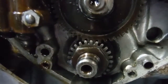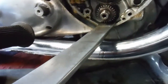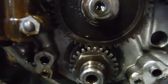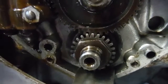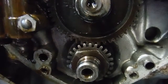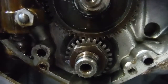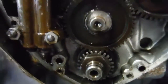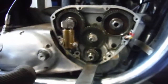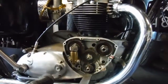Amongst other things, I found that there's a bit of play in the main bearing. Look at that lever there, just underneath the timing pinion — and hopefully you can see that. If you watch the oil from the teeth of the gears, that shows it up quite clearly: the play that we've got in the timing side main bearing, which is not particularly good to have. I'll take the oil pump off anyway and have a look, but it's looking like an engine strip rebuild at the moment unfortunately.